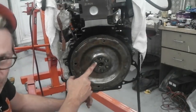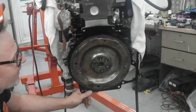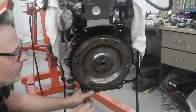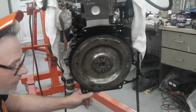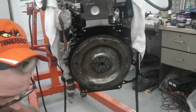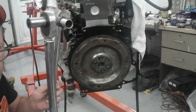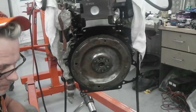I must admit, when I do these, I always think, are they really tight enough? Because there's no going back with them. But the combined strength of them, you know, 70 did click. And as I said, lock your crank, otherwise it just tries to spin the wheel. So lock your crank with your 19, and then torque up on the end. So that was it. They're all done.